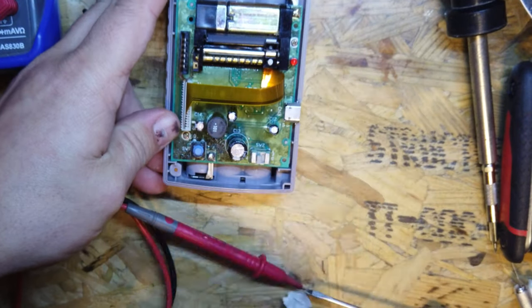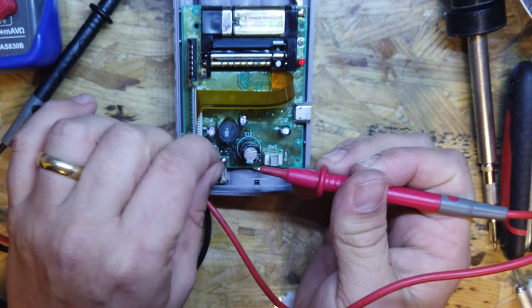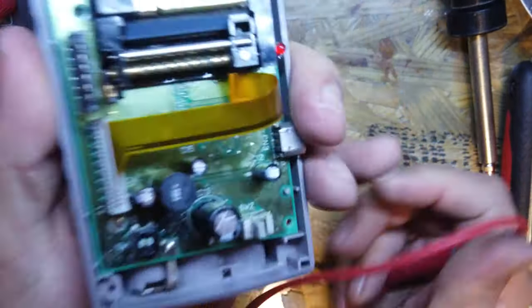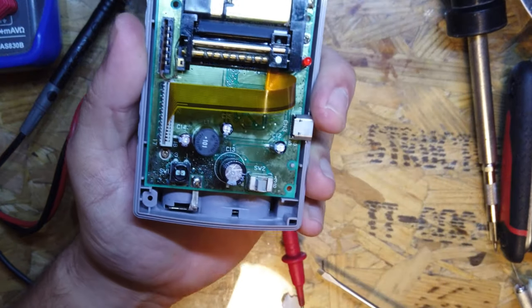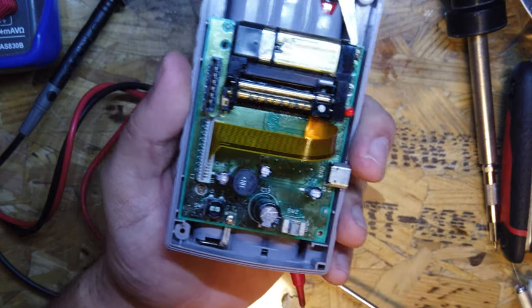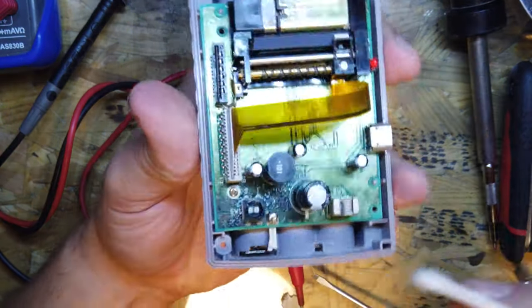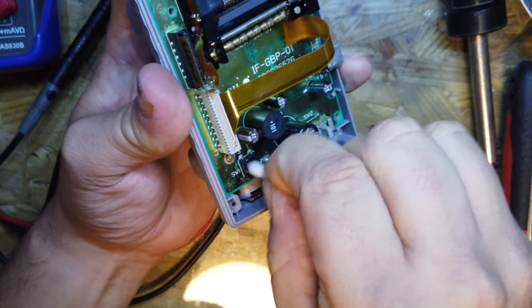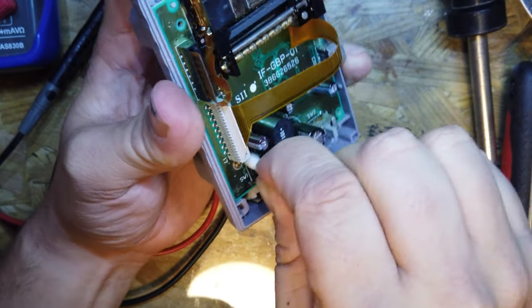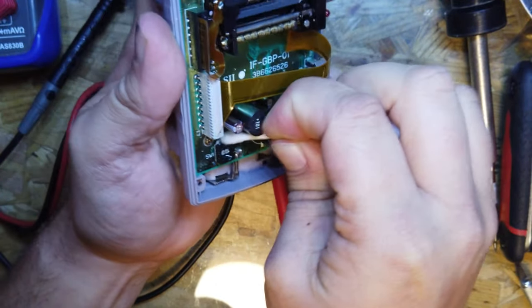I think it's this switch, but I'll take the rubber out. Okay, so inside of that switch is a little bit grubby, but nothing terrible. Get a bit of our good old friend IPA. I'm going to blast a load of that in there. What I'm doing is I'm trying to really clean around this on all the terminals now as well.